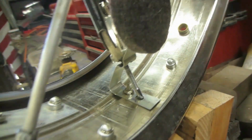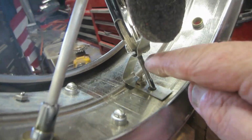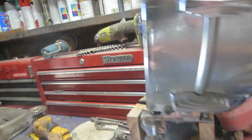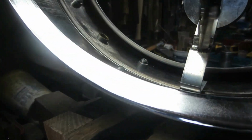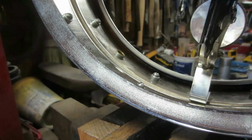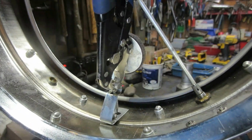Okay, so now if these tone controls are fighting you to get them off, it's because they damage the threads halfway through on this rod, so it won't back out on the player. So what I do is I put the knob in these wooden jaws. It won't ruin the knurling on there. I'd much rather do that than see a guy put some vice grips or something on that knob and mess it all up. So then I just put it down there, and I use these vice grips to turn the inner, well, round nut thing here, retaining nut.